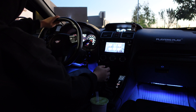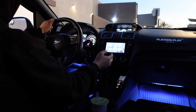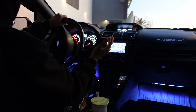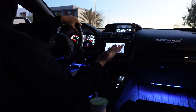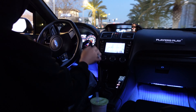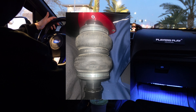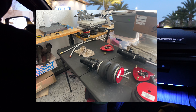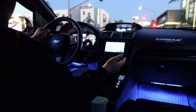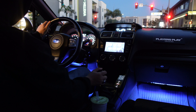There are some things that can go wrong with bags. When I first installed my air suspension I had no one to teach me anything, so I didn't know what to avoid. I just installed it and prayed everything would go right. It wasn't until I realized my stock wheels sat too close to the airbags — the actual air bellow up front — and it literally popped a hole through one of my bags, and the other had wear and tear. They were really expensive to replace.